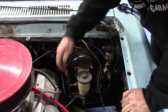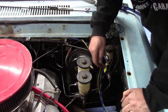We've got the line from the master to the solenoid and from the solenoid to the proportional valve - but that's where I screwed up. The line lock goes after the proportional valve. The correct order is: master, then proportional valve, then line lock. Let's fix it.